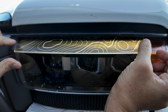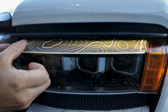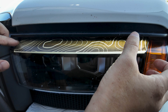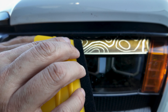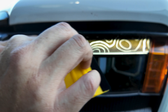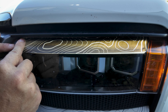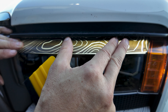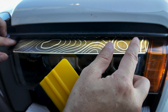I can look at it from the front to make sure that curve is uniform as well. Once I'm happy with where it is sitting, I'll try to use my fingers to push out some of that fluid, then switch to my felt tip squeegee — holding it down with one hand and gently pushing it with the other. You do want to do this installation in probably 70 degrees or warmer weather; it's a lot easier when it's warmer. I can lift it if I need to and realign it.